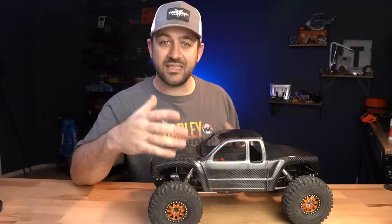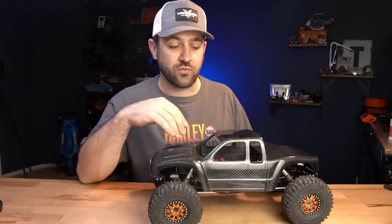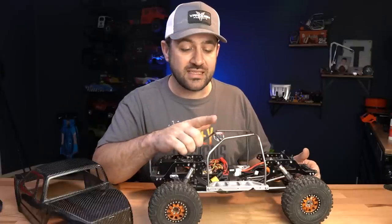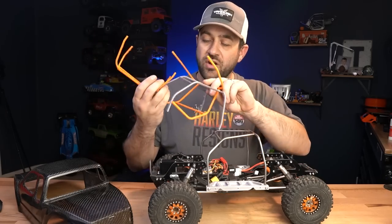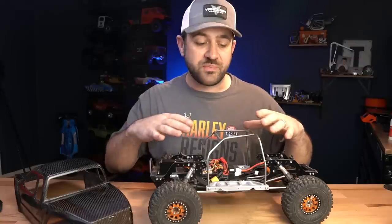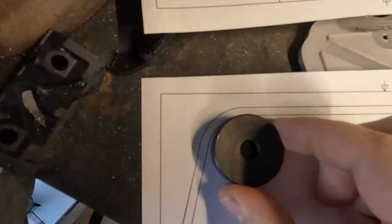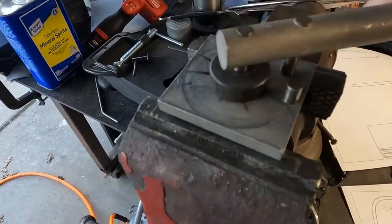In the past I talked about making sure this body is well supported, because even though carbon fiber is very strong, there's not a lot supporting a lot of it. If it took a big tumble, I was worried about crushing the roof. So I wanted to build an internal cage, and I've started that — as you can see, we've got the start of the roll cage in place. I decided to go with titanium to fabricate this cage. I was up in the air between DOM steel tubing and titanium, but I went titanium. I made a number of 3D printed prototypes until I nailed down the actual shape and tube structure, being picky so that the top of the roof and the A-pillars would closely match the inside shape of the body to get everything as well supported as possible.